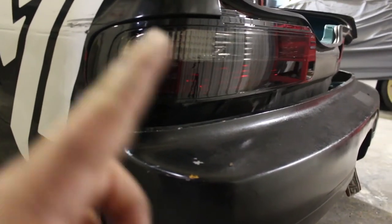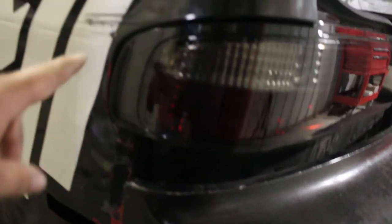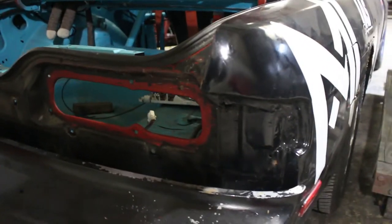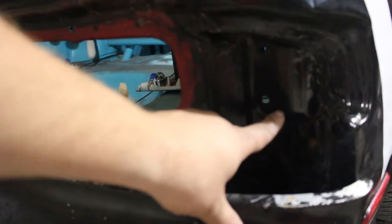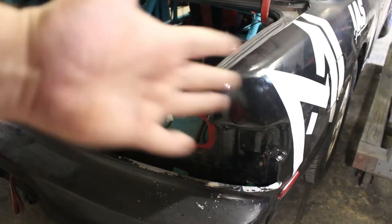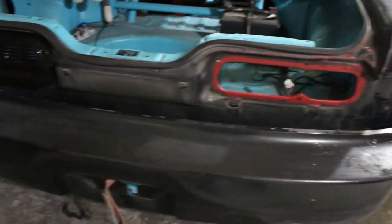I'll probably end up putting LED lights in here to make it brighter. Shout out to Rudy Nuxentire for this damage. On the damaged side I'm going to have to manipulate these two holes — I'm not sure about the fit up. I did some quick body work here just to get the car painted for the season, so we'll see how it fits. I'm going to get a burr and open these two holes out. This side was bashed in pretty good so I wasn't able to get it all the way back out, but for the most part it should fit up.